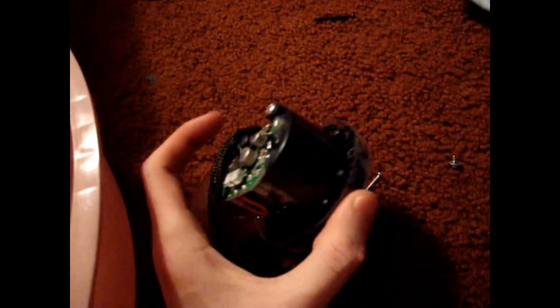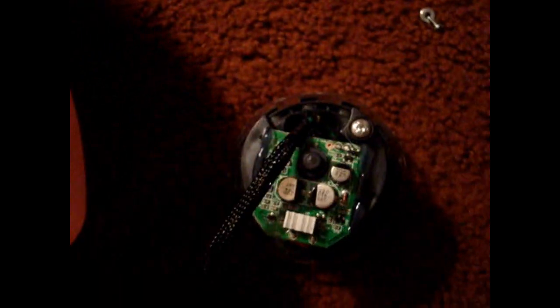You want to do this first, and then drain out the liquid from inside the radiator, and then try to get as much out from what's left over in the pump. Then next, what you would do — this is where the tubes are — you're going to take out this screw, and then take out that screw right there. With the light shining through, you can see those two. Then you'll be able to take off the cover of the pump. From there you're going to see this screw and washer, and with the tubes coming out, you're going to want to unscrew that. Then you'll be able to take the whole barbs and tubes out.